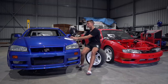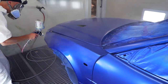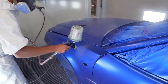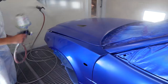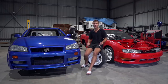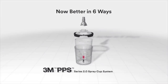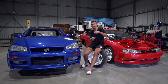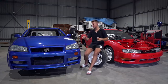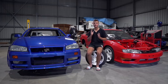What I did like about the gun is it sprayed quite nicely. The cup system is a 3M disposable cartridge system — I'll put some photos in. I absolutely love that you don't use a traditional pot that you have to clean out after every use; you just throw it in the bin, clean the gun, and put another one on. So going from color to clear takes about 20 seconds — just flush the gun out with a bit of thinners, put your new pot on, and you're good to go.